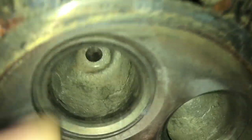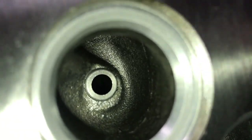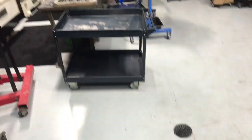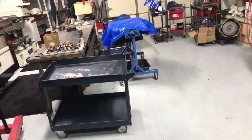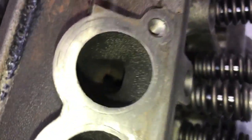I don't know about you guys, but that is clean now. That's casting — I'm gonna clean that up, get a little ball burr tool, we make them all look like that. This is the other set. That's why it takes so damn long — we don't just get them clean on the outside, we completely clean them. If a set of heads leaves here, either the customer will know they're not real clean, or we go through the entire cleaning process.